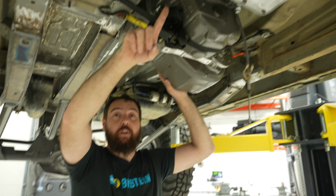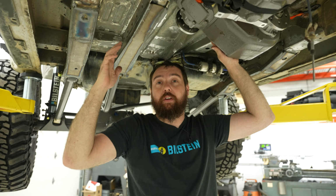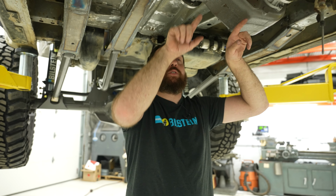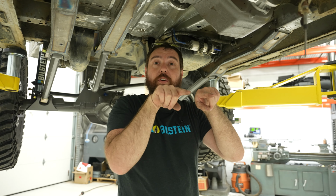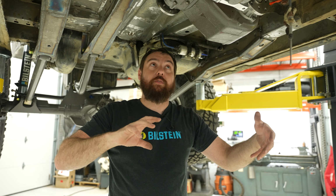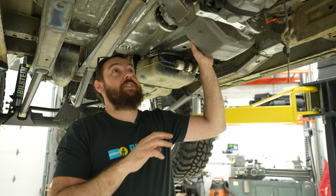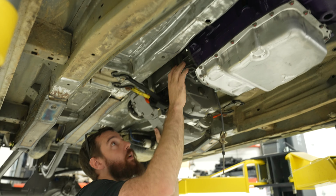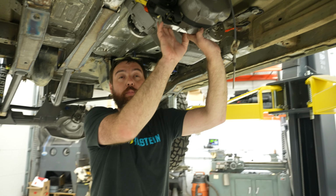I don't want it to be up front from the motor mounts, which is traditionally how you do it, like a stock BMW E36 or something. The trans mount tabs are really close together and they're not very strong. So you want the motor mount to be resisting the drive shaft twisting force. But because of the low range and everything here, and because this tail housing is known to be kind of a weak link, I wanna make sure this is the rugged part.